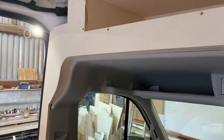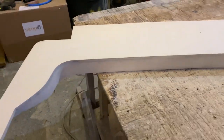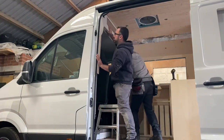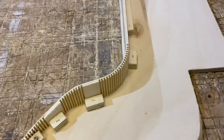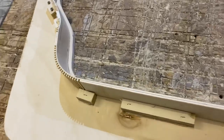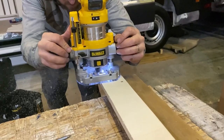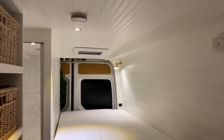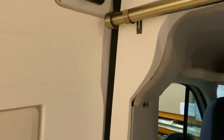One of the things I'm most proud about in this van build is some of the smaller detail you might not have even picked up on. If you've ever converted a van yourself and tried to box in those funny shapes around the bulkhead, you'll probably appreciate how much of a pain it can be. So what we did here was firstly create a storage box to fit on top of the cab, and then with the front of this we wanted it to follow the curvature of the headliner. We cut the back of the ply to allow it to bend and flex where we needed to follow the curves, then glued and pinned it all up so it would keep its shape. We applied a similar technique with the scribe that runs the length of the van and also on the curved pillars on the back doors. It took quite a bit of time and effort to get it right but I think it was well worth it after seeing the end results.